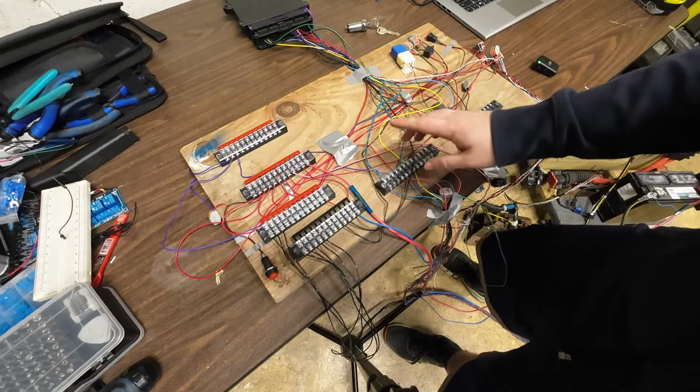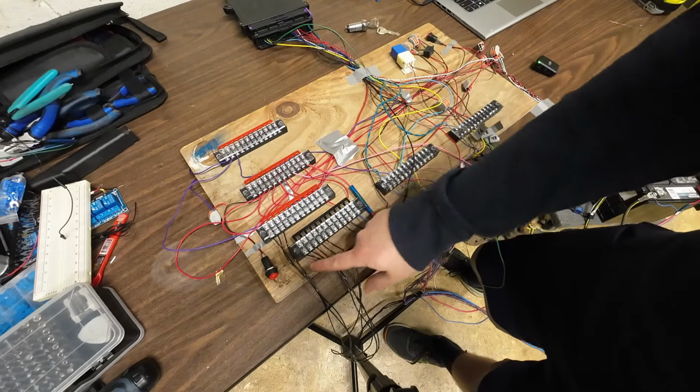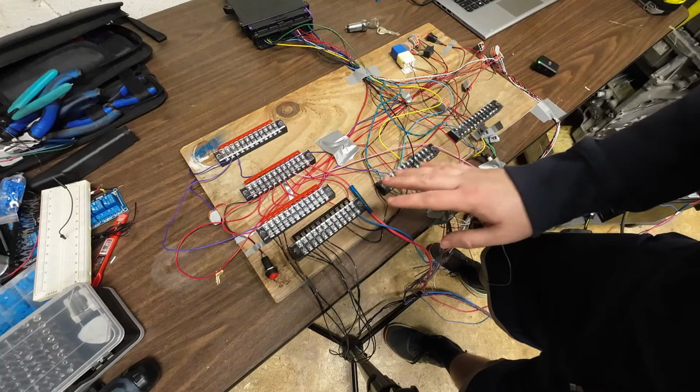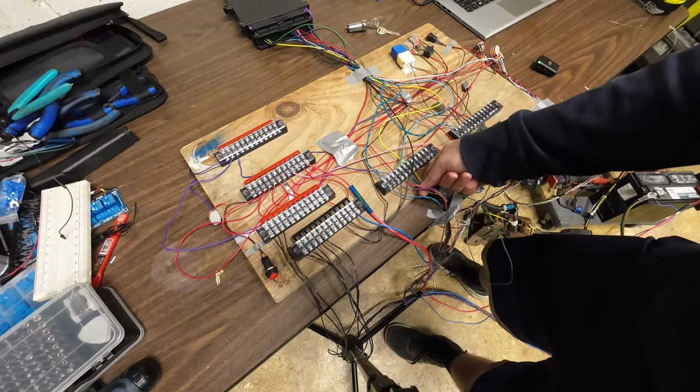Now, what I didn't realize is that for the LilyGo board for Dala's battery emulator, these wires are ground, and these over here are positive. For the Zombieverter, it's the other way around. These grounds are used as positive, and these 3 wires are used as your negative.